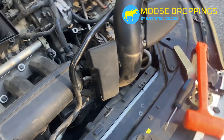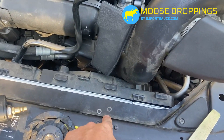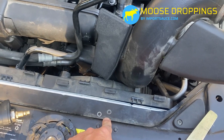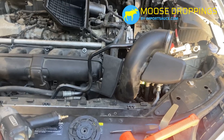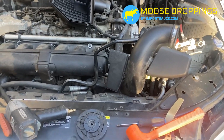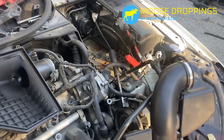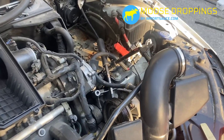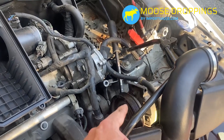There's not much more we can do — I may have a couple of 0.1 shims and could get four of those to put us at the bottom end of spec, which may let it last a little longer. We're going to put it back together. If this doesn't work, or if you're watching and want to test yours, here's how you test it: you turn on the car.